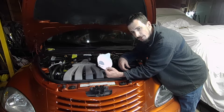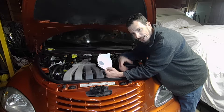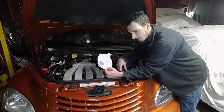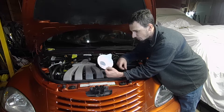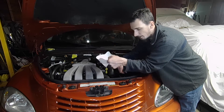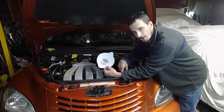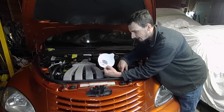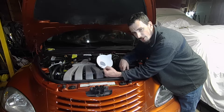You know how when you take a sample of your oil and send it out to a lab and they analyze it for bearing materials and all that? Well, this isn't going to be quite as accurate, but this is an awfully fine screen. If you drain your oil through it and it doesn't catch anything, you're probably good to go. If your engine is failing, it's definitely going to make chips of metal that will catch in here from failing bearings and stuff.